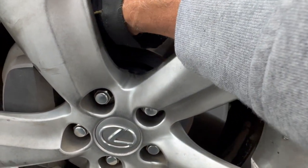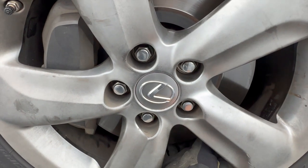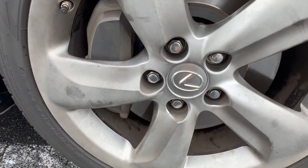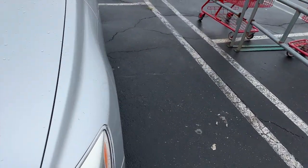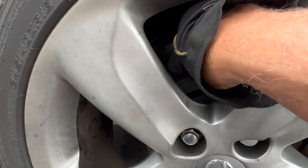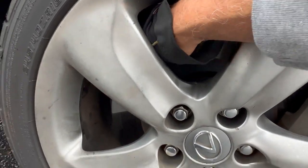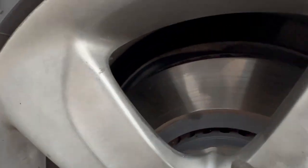You want this backing plate close to your rotor. I've learned in the past that it's not the brake pads or the shims or the wear indicators — I have new brakes, probably about two years old right now. You do the passenger side front wheel, then come around and do the driver's side. Reach in there and squeeze it — one thumb on the rotor and the other four fingers pulling the backing plate towards the rotor. Squeeze it together; you can hear it click. That's all you do — squeeze it.